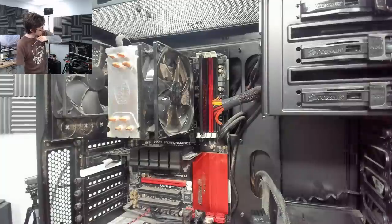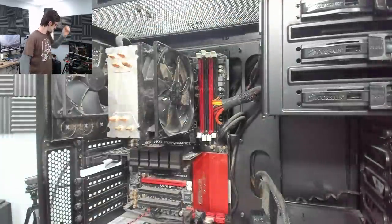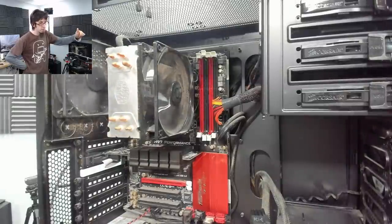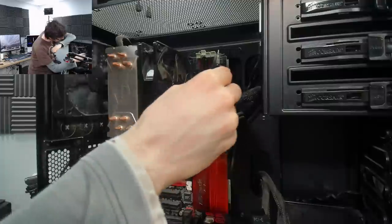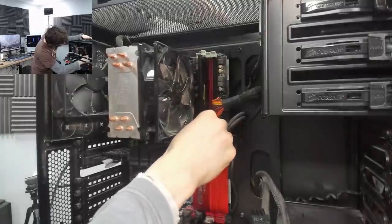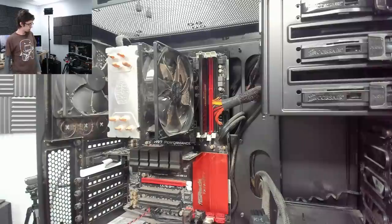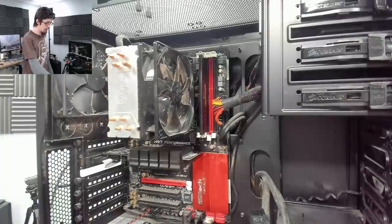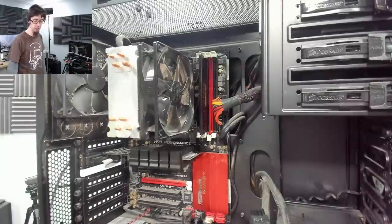Let's change gears back into some blind attempts. What do I get if I run no memory? Three long beeps. There's definitely a distinction between no memory and one memory stick in. I've no idea what the three short beeps or six short beeps is indicating. So I'm going to just swap out parts until it works — not the most technical diagnostics, but absolutely effective.